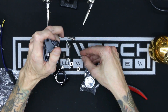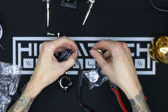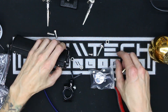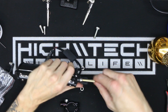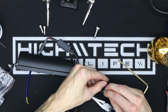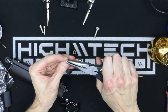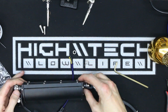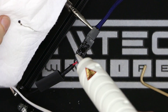Now I'm just trying to figure out how the mounting bracket is going to go. Unfortunately the handlebar mount tubes only come with 8 millimeter bolts and these brackets are a lot smaller, so I will have to modify those to get them to fit. The brackets that came with this light are a little too short and I'm going to have to fabricate some longer ones. Once I complete getting these brackets on and finishing up the connector, I can move on to the throttle issues that have been plaguing us throughout this whole build.